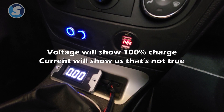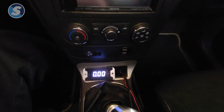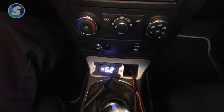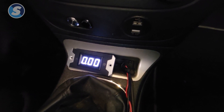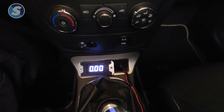We reached full charge on these batteries — it took eight minutes in real time. That time depends on the alternator and your batteries. Once we shut the car off, we'll see it bounce around a little bit — that's the dome light and things on the vehicle that are connected on the chassis ground side. That's perfectly normal. Once that dome light shuts off, you'll see it go to zero and everything will sit static. There we go — we can shut it off and go home.